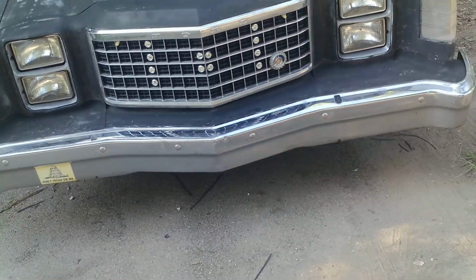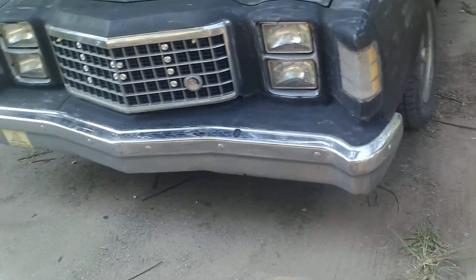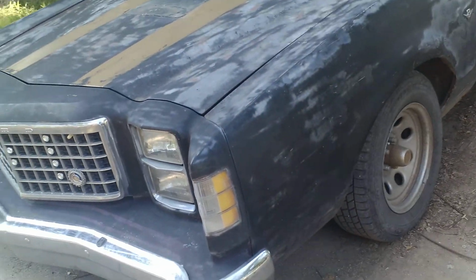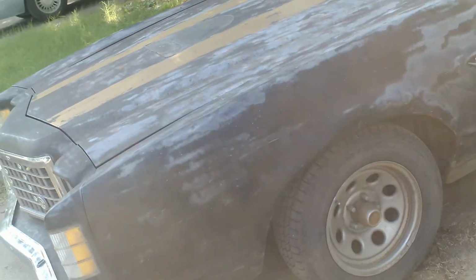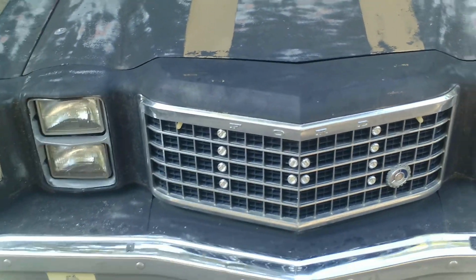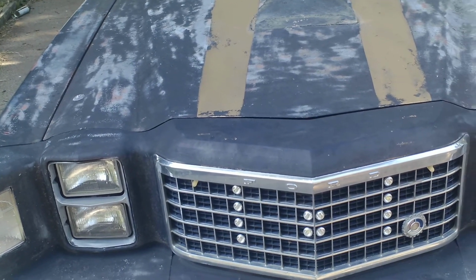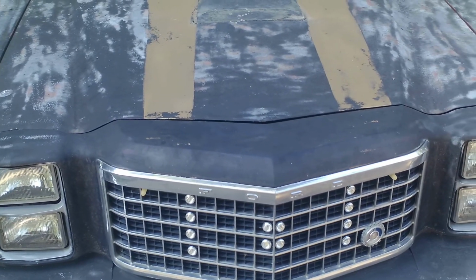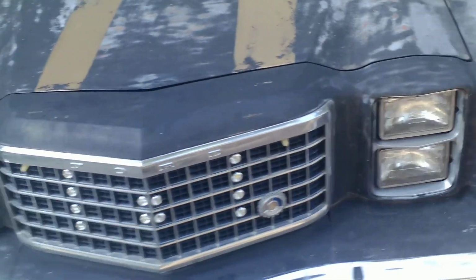Now, since I went ahead and tuned this thing up and adjusted it, I noticed that at idle, like at stop signs, just sitting idle in drive, the RPM is probably around 650, 700. And in park, it's probably around 700 or so. As a result, I can no longer hear my engine idle ever since I tuned it up and got the shake out of it, because it was shaking because it had a fuel-air ratio problem and a little timing issue.